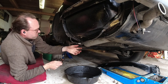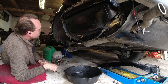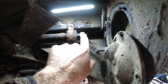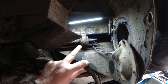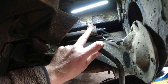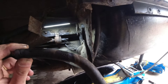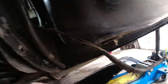I'm going to undo the other end of the pipe from this valve, slide it out, put the new hose in, and then replace that little gasket — hopefully the fuel system will be tight again. Here's the little hose that came off. There's the fitting and it goes behind the tank through there and onto the fuel return valves — there's one on each side, and they switch which tank the fuel returns to. I'll put on a new hose, scrub this down a bit, and put a little bit of wax oil on here. There's just a tiny bit of surface rust on the valve, nothing to worry about. Even though this hose seemed fine, we might as well replace it while we're in here since we have the whole cover off — you don't want to have to take that off too many times.